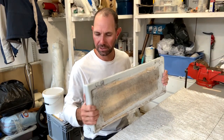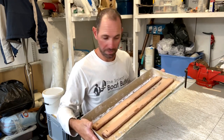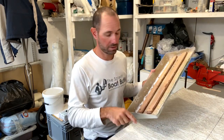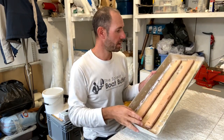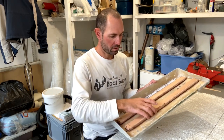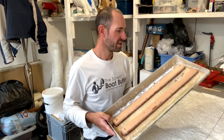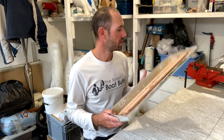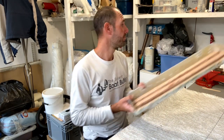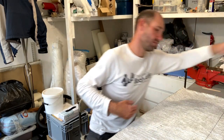Taking the weights off the locker lids — these have stiffened up just with these little bits of plywood considerably, so that's all good. The next job is to cut up some glass. I've had a quick measure up to work out how much I need to lay up glass across these wooden strengthening pieces — I don't think stringers is really the right word, formers, whatever — anyway they do the job, so I just need to cut some glass up and then I can get laminating.